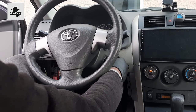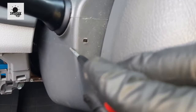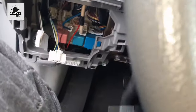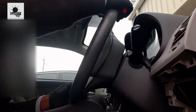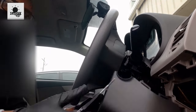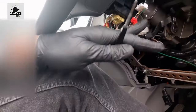I'll get my car key and turn the ignition just to the on position. You'll use a screwdriver to push the release tab back, then turn the steering wheel around to access the other side and pop those clips open as well. Once both are done, you'll see the cover pop open a little bit. Now I've got everything exposed.